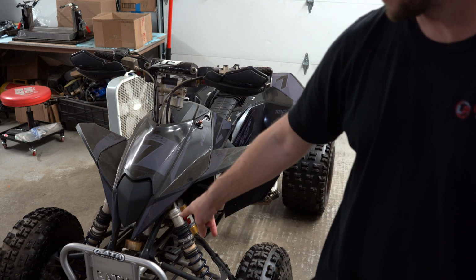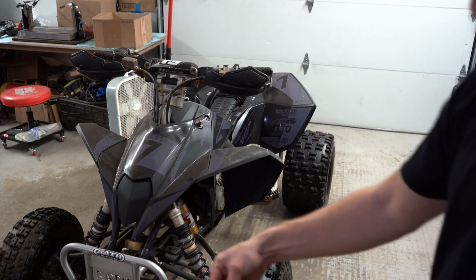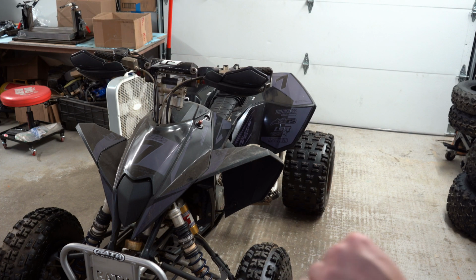But other things that were cool, they pre-made a mount on the frame along with the steering stem having a tang on it to direct bolt an Öhlins damper on it. So Öhlins was directly involved in that, like it was almost like the factory Yoshimura stuff for Suzuki. Like, you can buy a damper at the store, 2 bolts, and you got a badass steering setup.